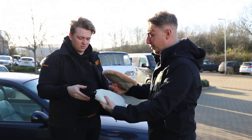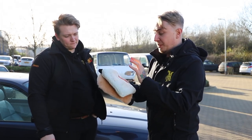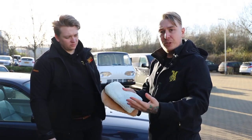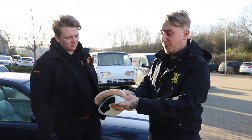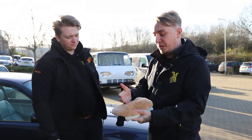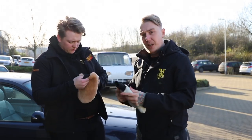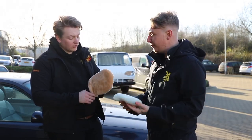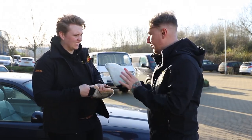We have two wash mitts. The microfiber has a good pile on it, and the big point of this is longevity — it can be machine washed like your microfiber towels and drying towels, so you're going to get way more use out of it. The lambswool is a deeper, plusher pile and also has gauze on the back for stubborn areas around the bottom of the bumpers. It is plusher and softer on the paint, but because it's natural, you cannot machine wash it — just rinse it out and hang it to dry. Personally, I use the microfiber on wheels because I can machine wash it, and the lambswool on bodywork. But for this heavily dirty car, we're going to be using the microfiber.